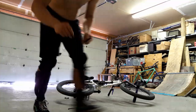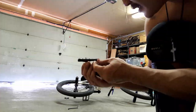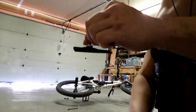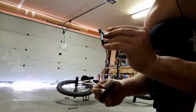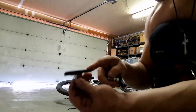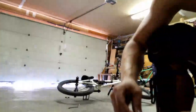So we're going to put these new brake pads on. You can see this one is basically ground down to the pulp — compared to this one, you can see how much worn down it is. It's starting to affect my brake, because there's a metal piece that starts sticking out, and it'll start rubbing on your rim, and you get less brake power.